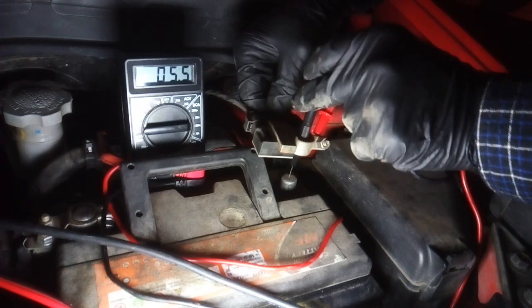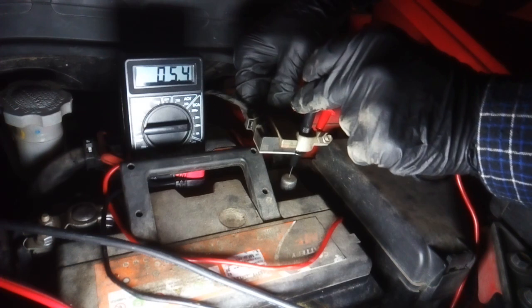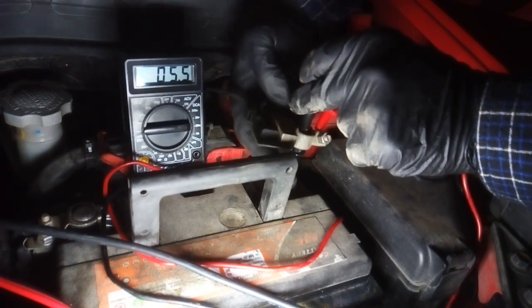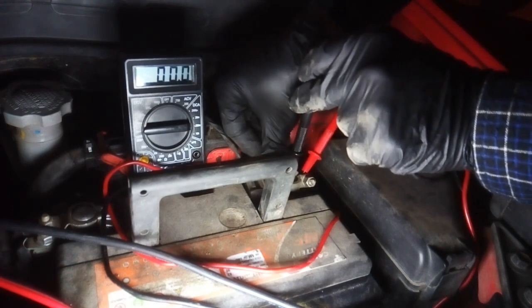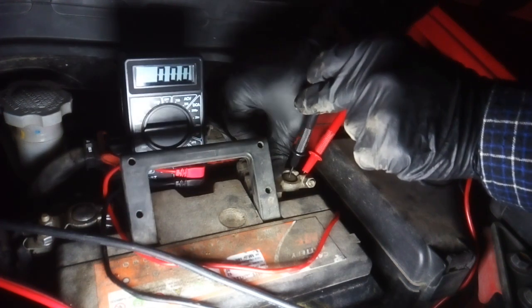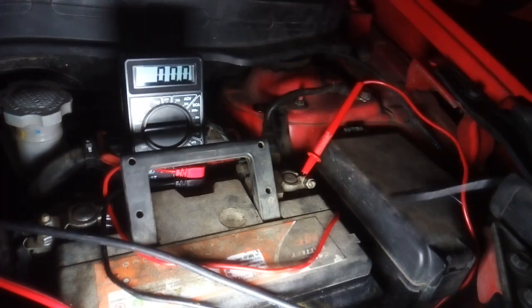This is current that is called leaking from the battery. If you have some kind of leakage in your electrical system, that's a neat way to measure it without actually disconnecting the terminals. You can place it back in position, and in a few minutes you have measured your current leakage from your battery when the car is sleeping.